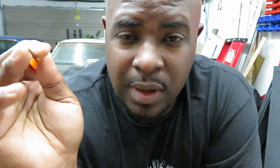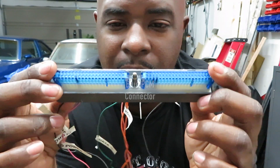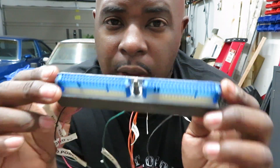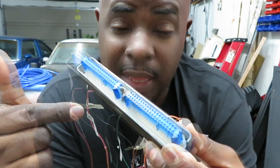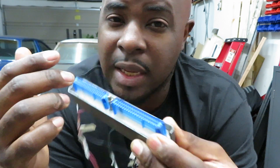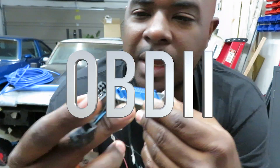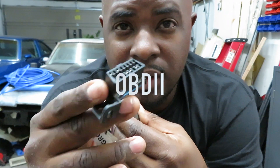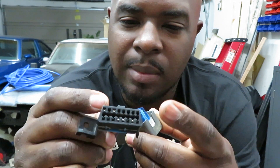Something to get the pins out leads me on to the next item: your actual PCM connector — the blue connector. Red isn't useful, you need the blue one. I went to the junkyard in my last video and picked up a blue connector. I also picked up an OBD2 connector — this one has a little broken clip, but all we care about is the connector itself.